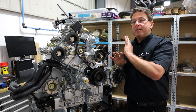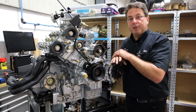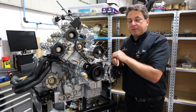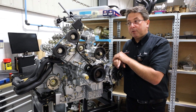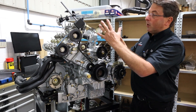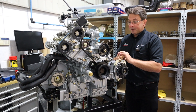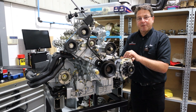Some people make this far more complicated than it is. It is easier if you're doing standard camshafts with the data to go with them — otherwise you really are into working it out on dynos. For factory stuff, keep it to the data. Every cam will be different — even in Ferrari land, GT4s are different to GTBs, carburettor ones are different to injected ones. It's also a nice chance to show half an engine: fuel going in this side, the exhaust coming out, and the pistons sitting this side. These are very pretty engines — one thing Ferrari do is make very pretty engines.